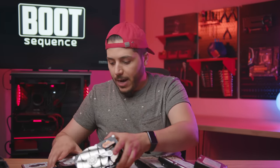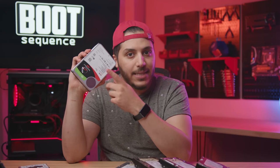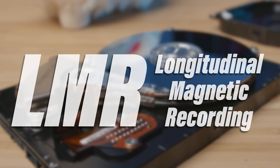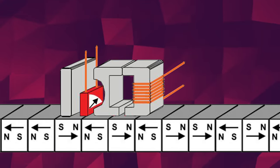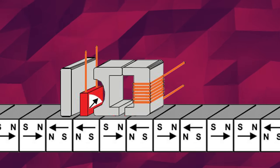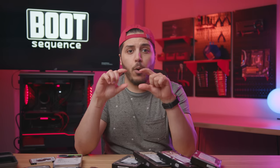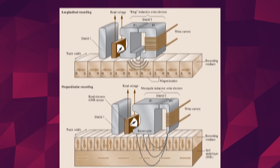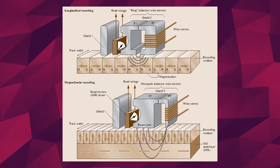This drive from 2006 is still the same size and form factor as a modern one with 64 times the capacity. Originally, drives used LMR — Longitudinal Magnetic Recording — where grains were magnetized along the disc with poles going left and right. One major breakthrough is PMR, or Perpendicular Magnetic Recording. With PMR, you take the bit and rotate the pole 90 degrees, placing bits closer together for extra capacity. They had to innovate the write head technology too, going from a ring to a monopole style write head. This changed the game so much that it's now just called conventional magnetic recording.